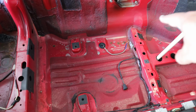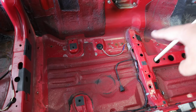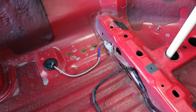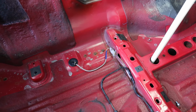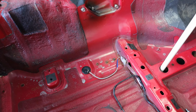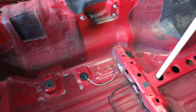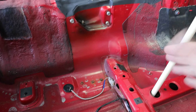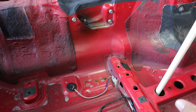So I think if I take the two wires, the blue and yellow wires coming from that probe, and splice those together, hopefully it'll always read a 12 volt constant, and I don't have to worry about that light coming on. I know I could just leave the light bulb out, but I think just defeating the system right now will leave further options if I want to use that warning light for something else in the future.